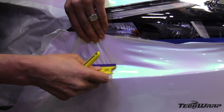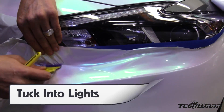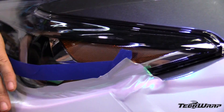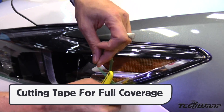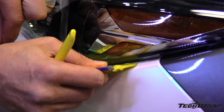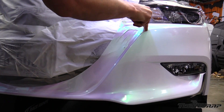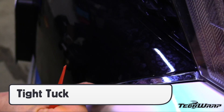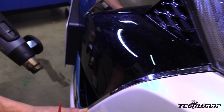For lights, tuck the film into the base to avoid overstretching. Once set, use cutting tape to remove the excess film. When pulling away the cutting tape, the wrap film will be tucked under the light for full coverage. For areas where the grill is, cut on the molding side — called the empty side — then form the wrap film onto the solid side, which is the bumper.